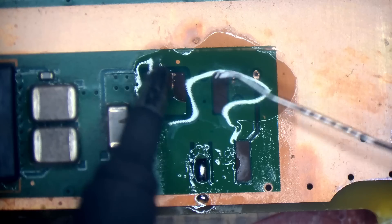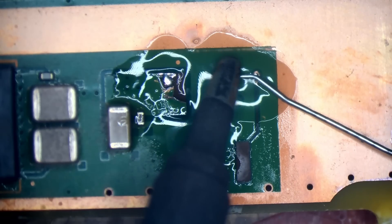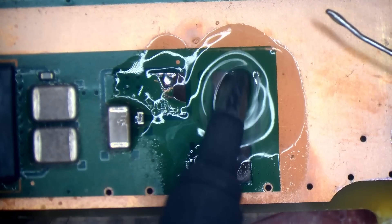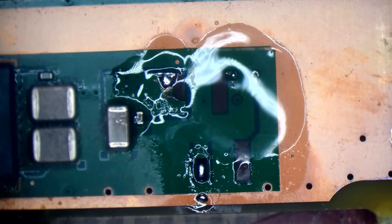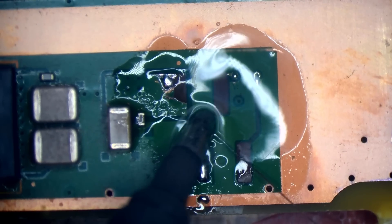There's the ground pad tinned, there's the five volt tinned, and then we've got these — I think they're just signal lines. I don't know exactly what they are but I still need to restore them, because one of these pins tells the 12 volt to enable. The 12 volt doesn't enable until you turn the console on, so it has to talk back to the power supply — I think it pulls a line down or something. Now we're going to get some 0.1mm jumper wire.